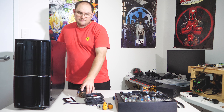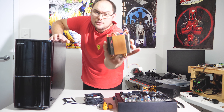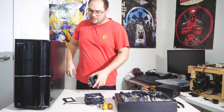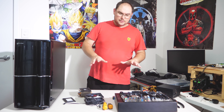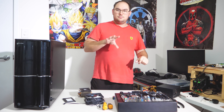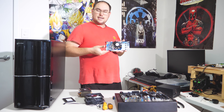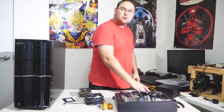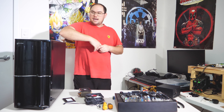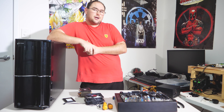We'll be going with 16 gigabytes of DDR3 RAM — spare RAM, and I'd like to have 16 gig in everything I make. For cooling we're using a rather good-for-the-time AMD heatsink with a copper heat plate on the bottom, a bit thicker than the stock cooler, so cooling potential should be enough for an FX CPU. At stock TDP that cooler will be perfect. For the graphics card, it is a 9600 GT — a 13 to 15 year old graphics card. I don't believe it even supports DirectX 11, and that is where our OS choice comes in.